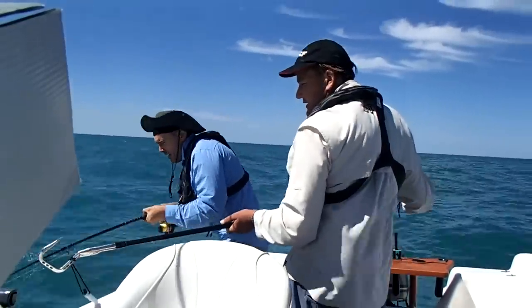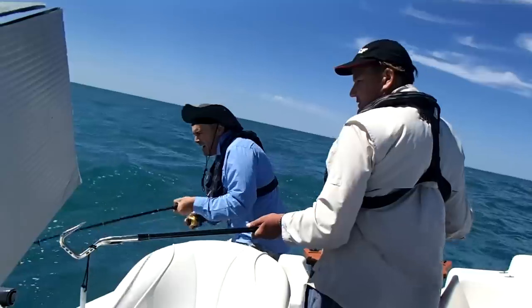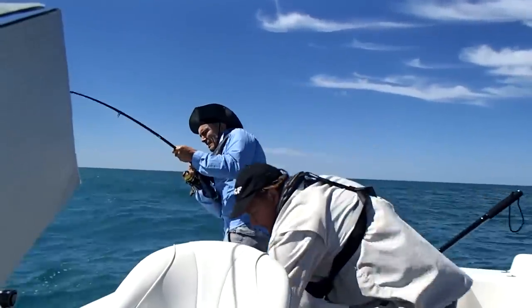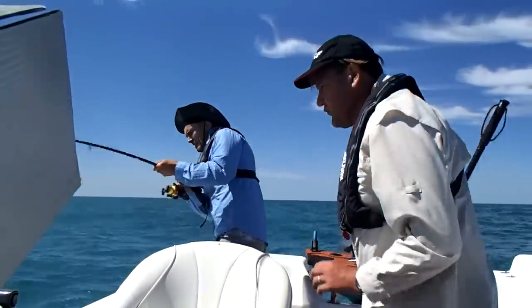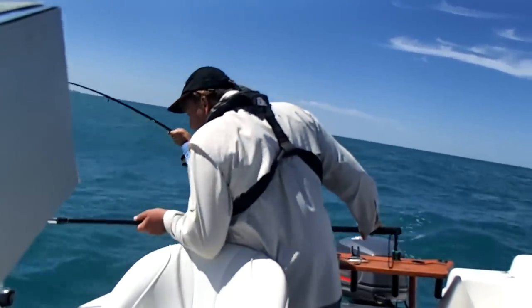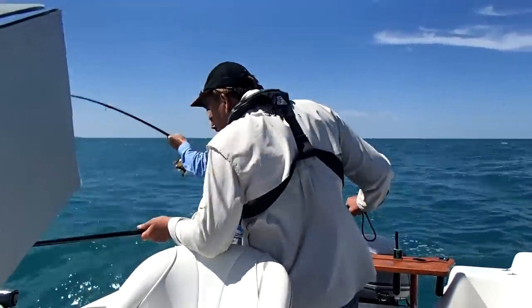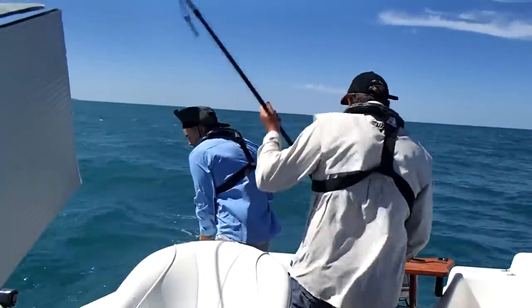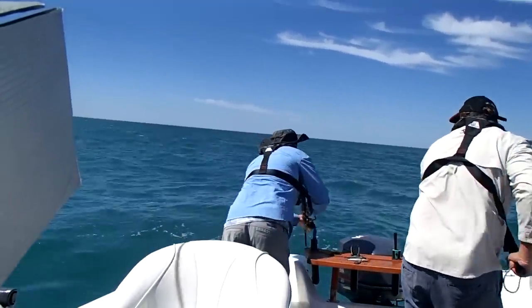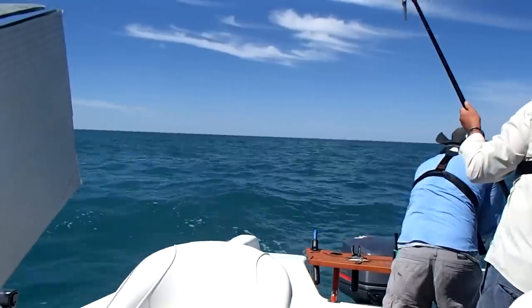As far as the four-stroke goes, fuel economy is excellent — probably the biggest feature of the four versus the two is the economy, almost double in some of the rev range. It's perfect for long low-speed drives as you're trolling for tuna or something, and if you just need to be on the plane at a slower speed in rougher conditions, it's perfect for that. It really holds its speed with the extra torque down low. Obviously no smoke whatsoever, and nice starting in all circumstances, even if it's cold winter or it's been in the shed for quite some time.